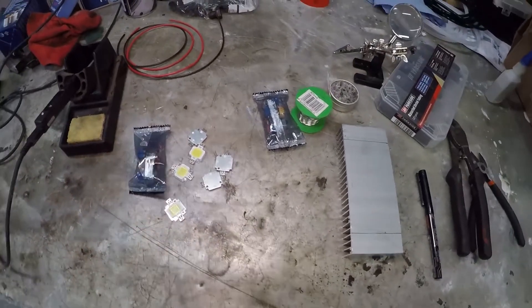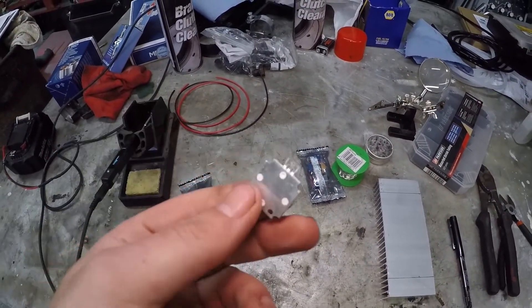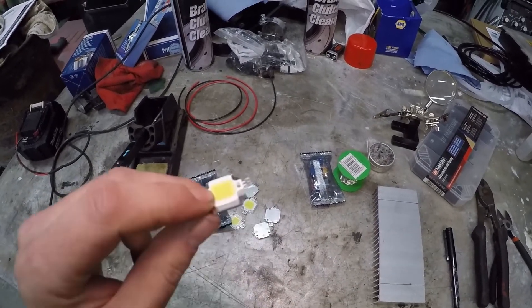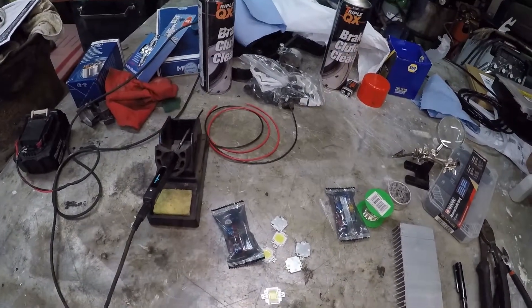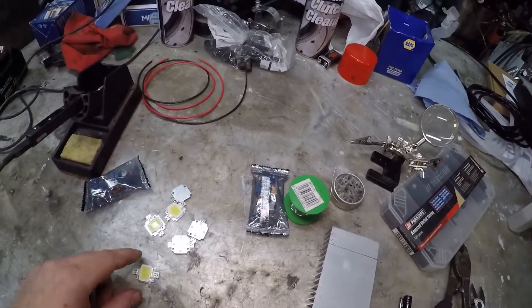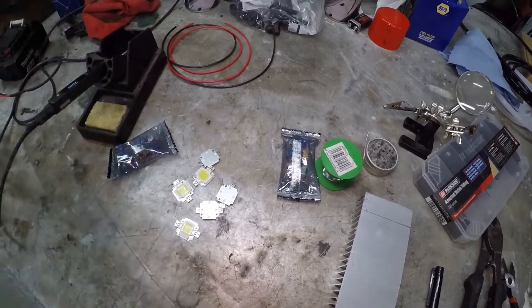To do this we're going to need some parts. Mainly we're going to need some LEDs. What I use are these little Chinese 10 watt LED COBs. I find they're actually quite reliable. I buy them direct from China and you can get like 10 of them for about 3 quid — basically nothing. We're going to need 6 of these: 10 watt, cool white, cheap and simple.